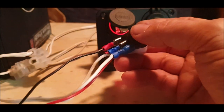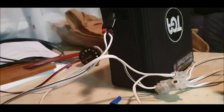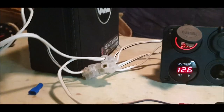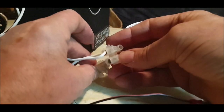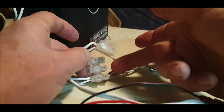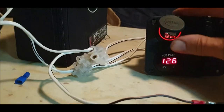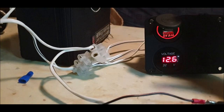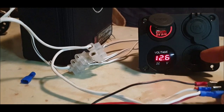There we go. What I'm trying to demonstrate is you've got your battery there. A bit of a crude terminal connection, but it wouldn't be. It'll be crocodile clips onto a main battery. And then you've got your block connectors here, which is your two block connector for your negative, a three block connector for your live, but I'm saying you can still loop, so you've got that to contend with as well. You've got all your USBs working, the cigarette lighter is working, the voltage reg, which shows you what voltage is, which I use on mine because I need it for the solar panel, and then this will pop in afterwards after I saw it off.